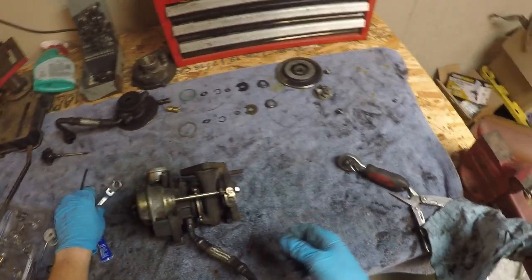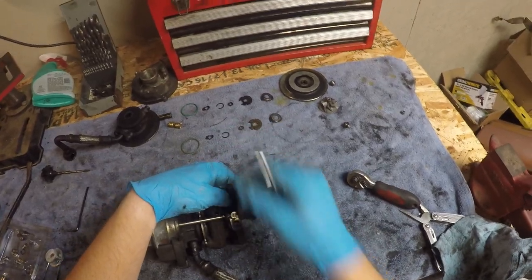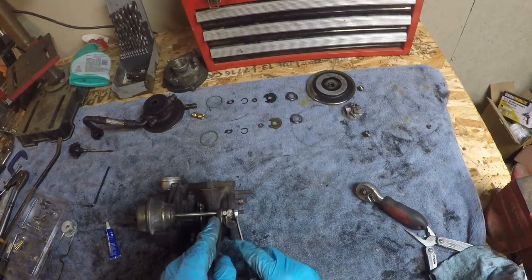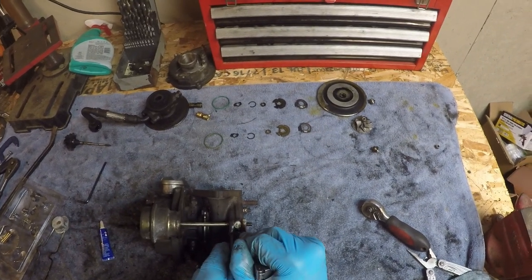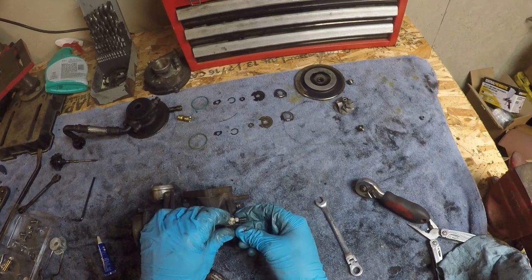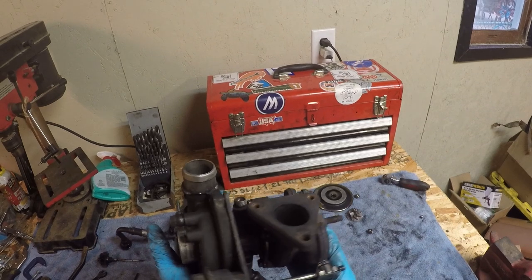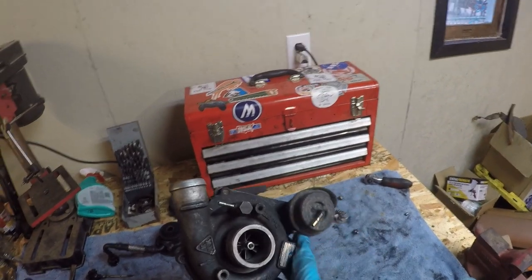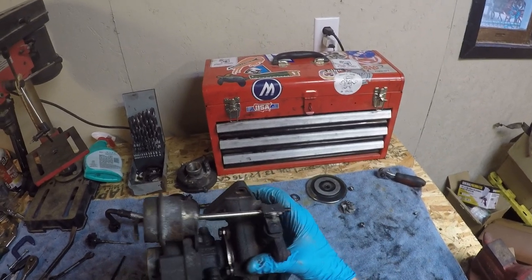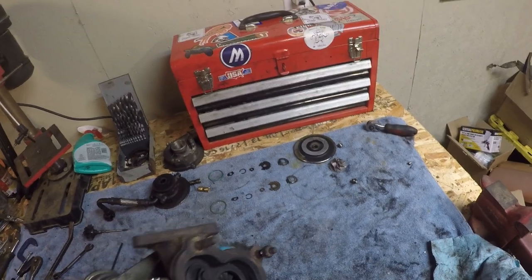Lastly, we're getting that wastegate actuator rod ready — drawing it down to the point we see in the reference pictures and paint marks. It does have a little bit of spring force to it, so don't be too worried. Getting another wrench to tighten it down on both sides. Not too worried about Loctite because this has got its own retainer. And it's the last piece of the puzzle — the retainer just pushes on until you hear a click. And that concludes our K03 turbo rebuild. It's nice and tight, no shaft play — hopefully it won't be leaking. I highly recommend if you do this yourself, put a GoPro on it. The footage was invaluable. I hope this video was helpful — thank you and have a good one.